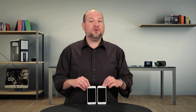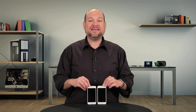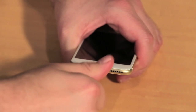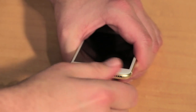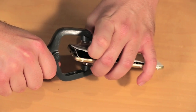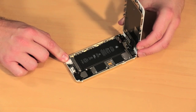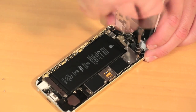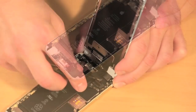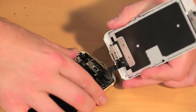Now that we've looked at the phone's outside, it's time to break out our tools and take a look at the inside. To crack open the iPhone 6S, I removed the two Pentalobe screws located along the bottom edge, and then used our handy opening tool to pop loose the display. Now with the front panel opened, the first thing we're going to do is remove several metal plates which cover connectors for the battery, front panel, and other components. We'll then disconnect the battery and remove the front panel.